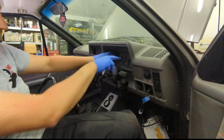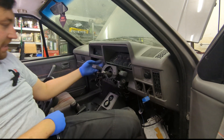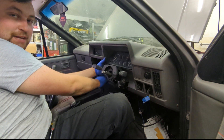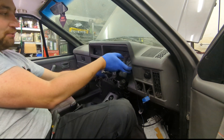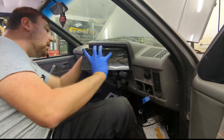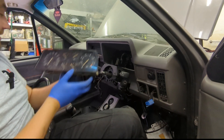To get the speedo out, you literally push the top corners and it pivots out. Once this panel's out you can get to the back — put your finger on the speedo cable drive. There's a little sprung clip, push it at the bottom and it will pull forward. Then it's just a case of unplugging the plug out the back, and that is the speedo out.